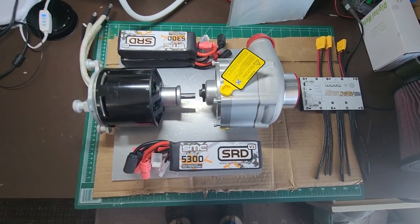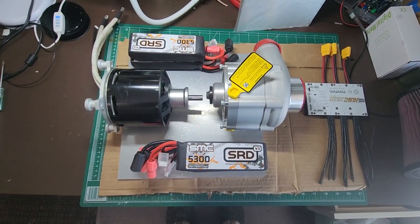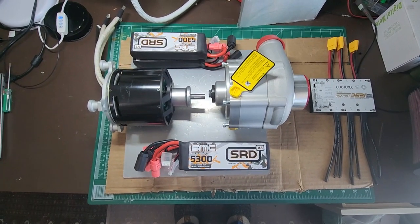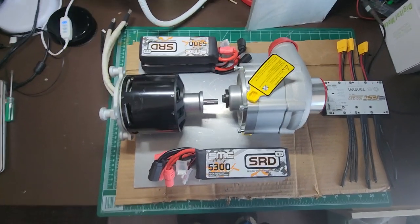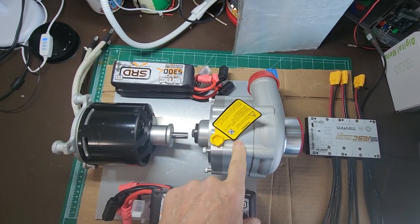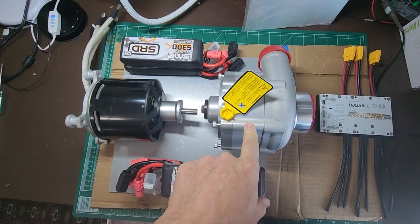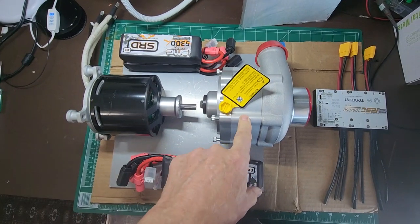This is my attempt to put an electric supercharger on my Honda S2000. These are the parts I've got. I've got a Rotrex C30-94, which should be about the right size to boost the Honda from 240 to about 350 horsepower.